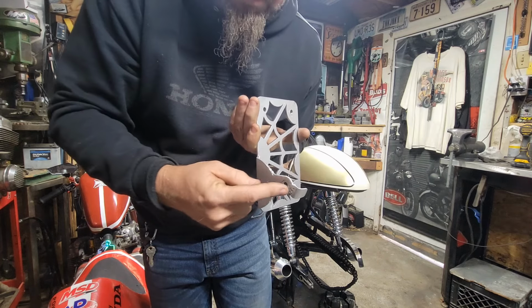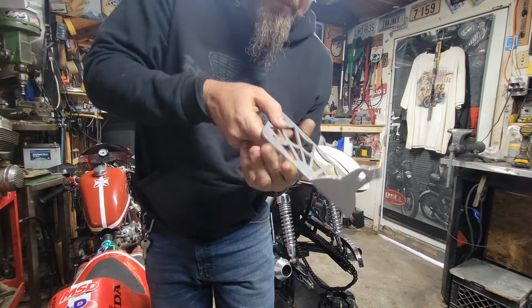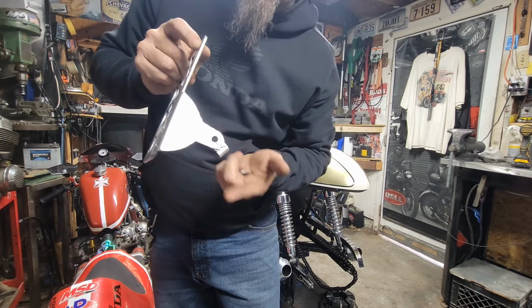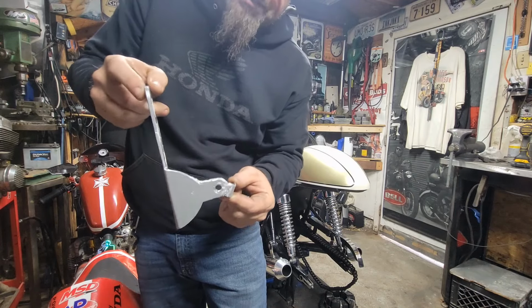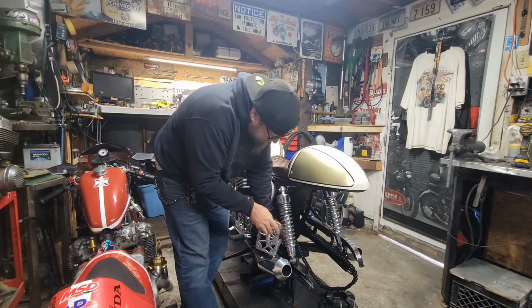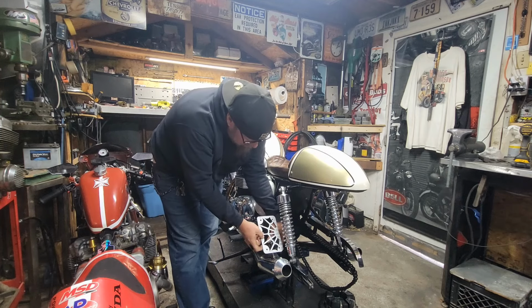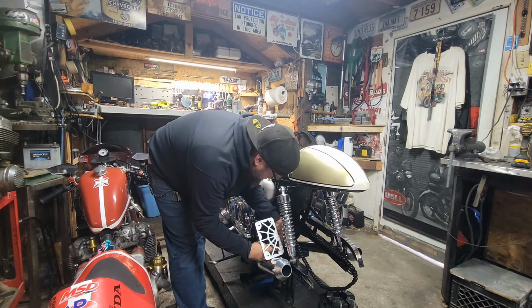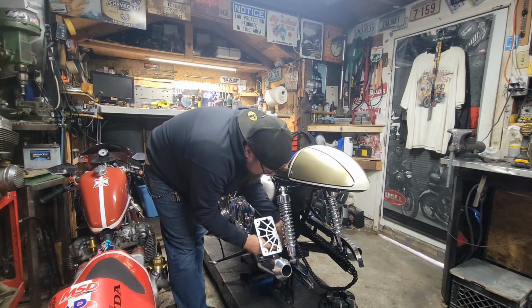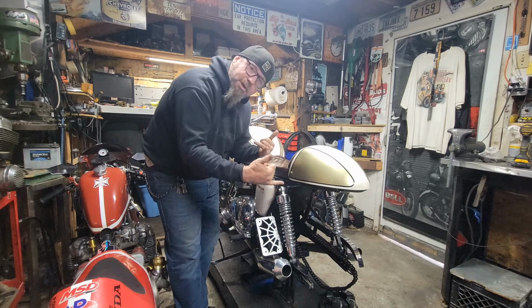I put an extra bead, so this part is soft, this part is hard from the weld, and it'll strengthen that top edge. This bracket, I learned this from Yamaha years ago. If you want something to stay, tell it to. That bracket goes down and holds against the back of the mount so that when it pivots down, it stops. Just get it on there correctly. There we go, and you can see once it's all bolted together, yeah, it stays in place, and the wind is going to blow it here, so it's not going to move, and it's going to be good.